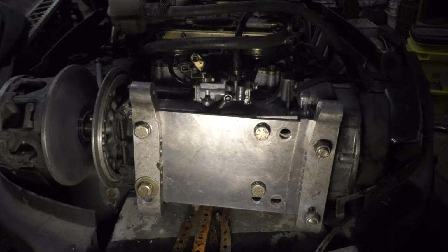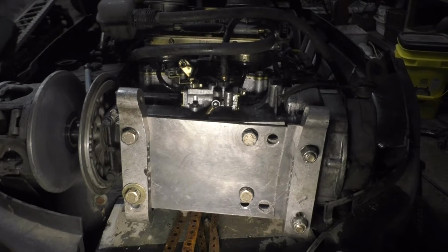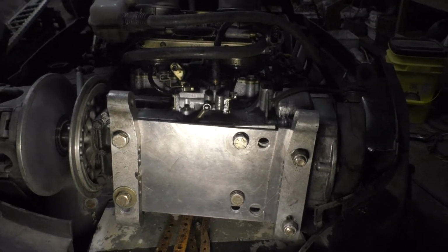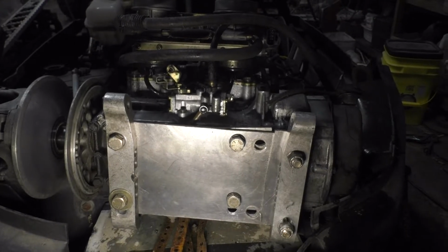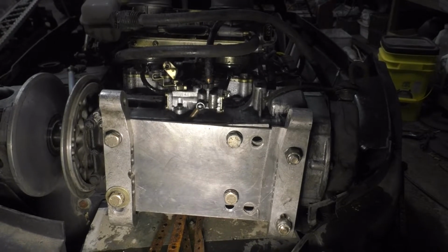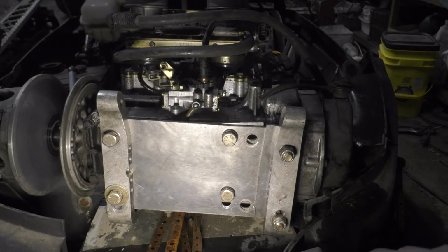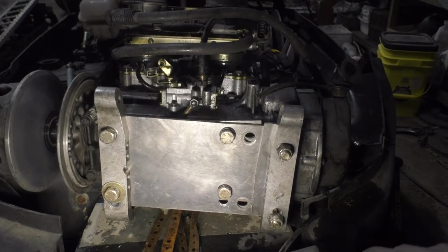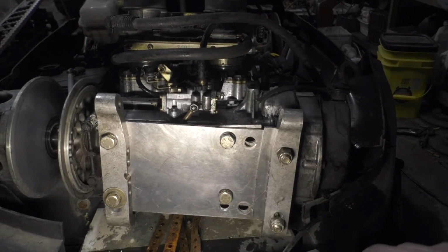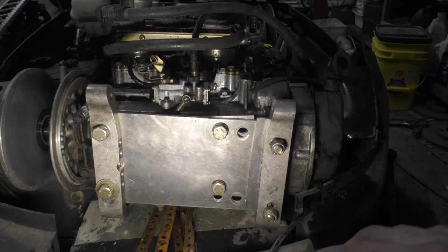But you generally want your clutch to be a couple of degrees forward angled from the secondary. I mean, straight up's okay, but most things say I think it's 2 to 3 degrees, so that when it's under load and it's pulling on the engine mounts, it doesn't go negative, or isn't kicked at an angle. You're supposed to have that slight bit positive so that when it's under load, it actually sits straight. But we'll have to see how that goes when it gets in there.